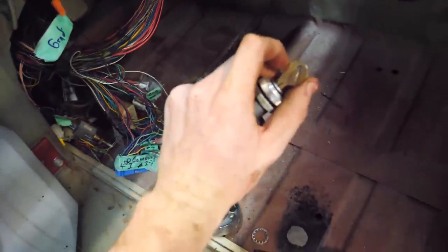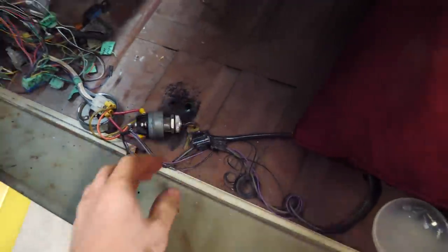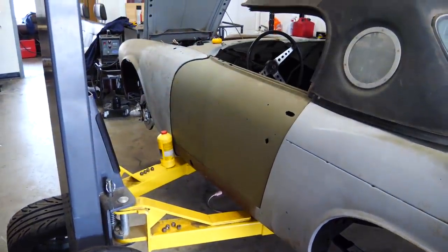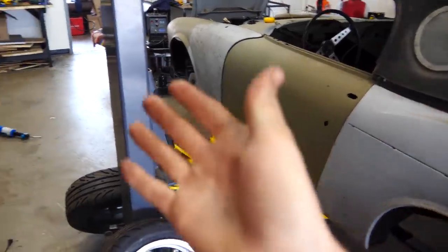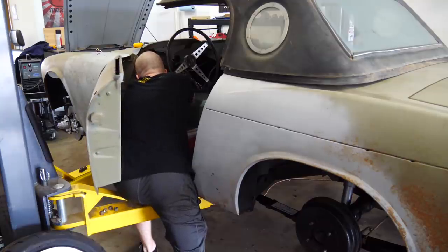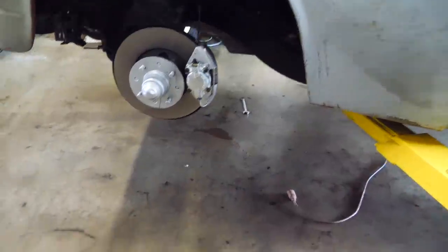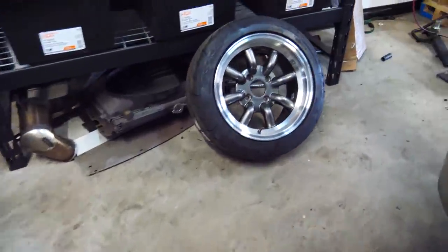Does it still have battery? Yep. I've discovered the clutch pedal needs to be bled more. Audrey already left, so I'm gonna try to do it myself. Trying to find the right thing I can stick on the clutch pedal. Looks like probably the slave cylinder is bad. You know, no matter how much I bleed it, it just won't go into gear while it's on.